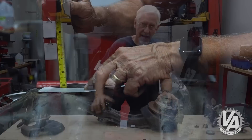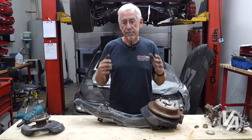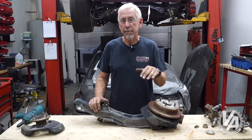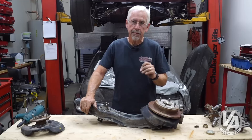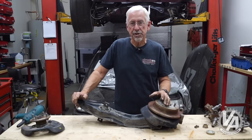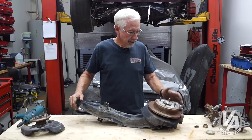That's not a big deal if it's a street-driven car and you're just trying to do a rear disc conversion for the look. But it is going to be a problem if you're going to be road racing your car. You'll need a greater offset to get the tire on there, and widening the rear track makes the rear end more stable — which is not how you want to drive a front-wheel drive car fast. You want it a little bit loose. When we built our Time Attack DA, we actually put EF rear trailing arms on it to narrow the rear end, which allowed us to run a larger tire, made the car a little looser coming into corners, and made it handle better.